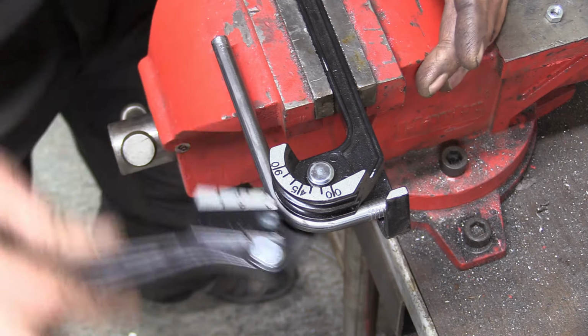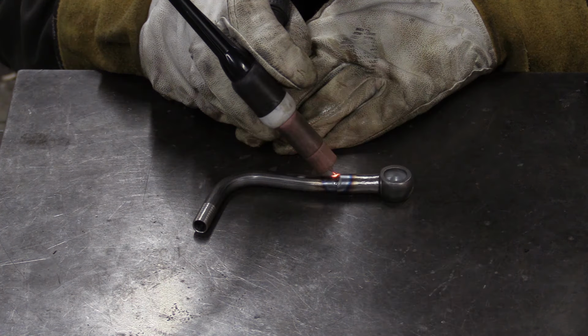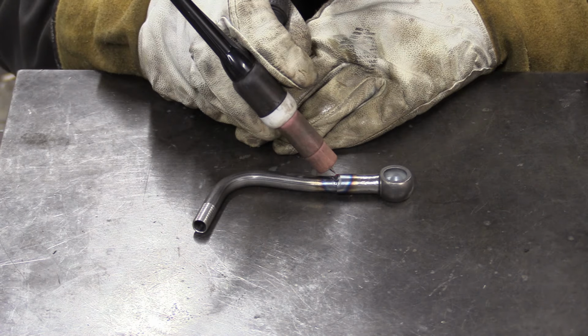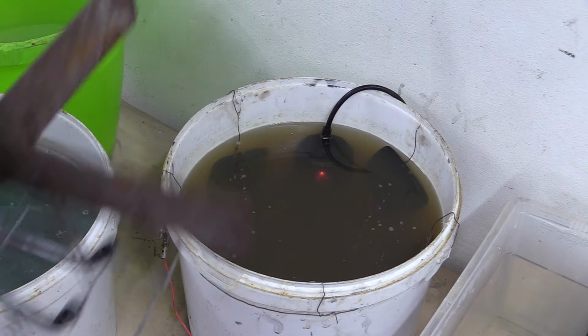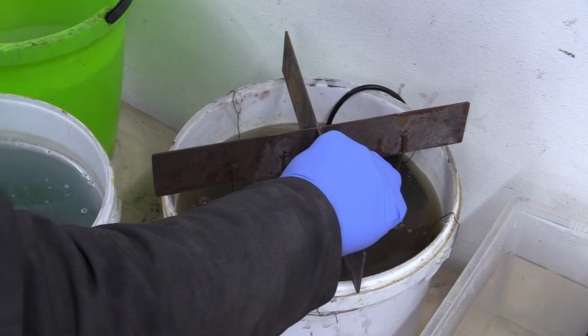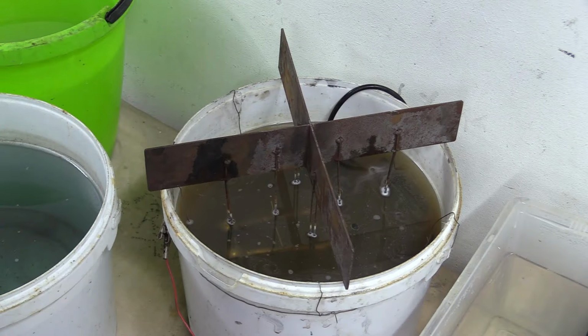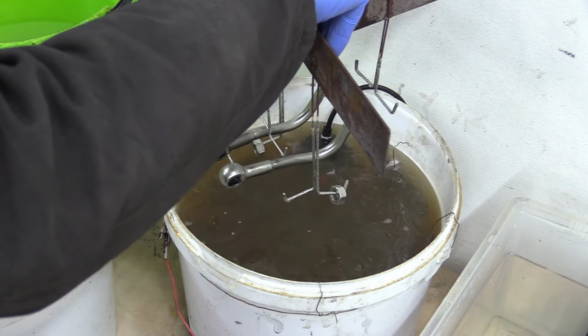After being bent through 90 degrees, the new metal tube is carefully TIG'd onto the banjo. And there you have it, a water feed tube that won't melt in the heat. It's no good painting these water fittings as they're going to get very hot indeed, so we've broken out the plating kit once more to put a nice gold passivated finish on them. That should stop any corrosion as well as being sufficiently heat resistant.